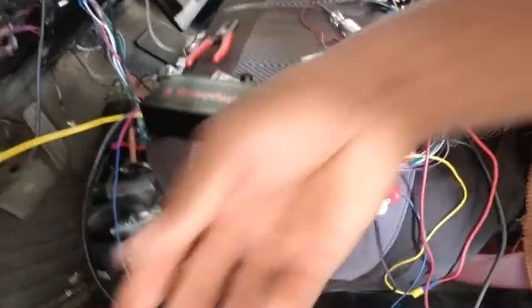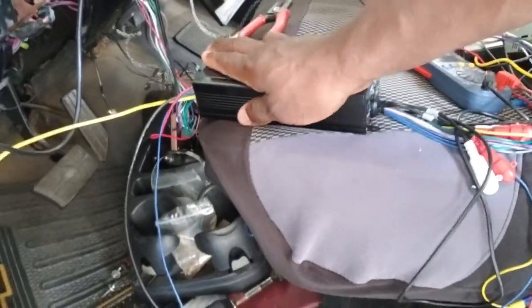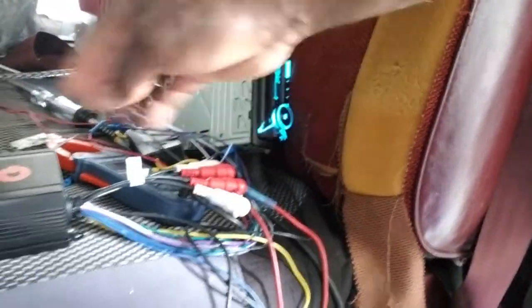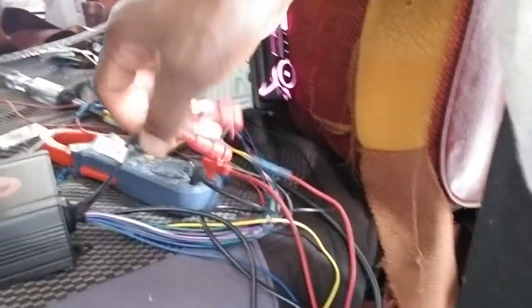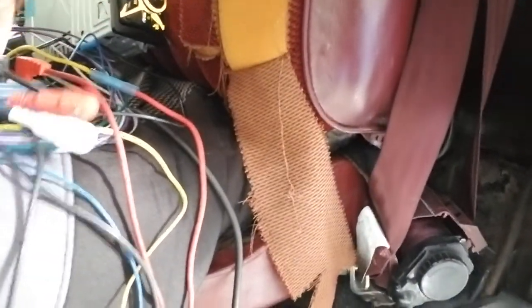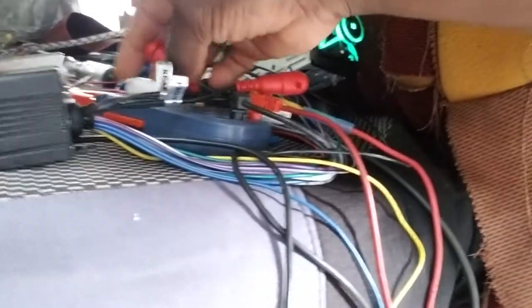I hope this helped. As you can see, I do have the little amplifier hooked up and it's really pushing these speakers real good — I'm pretty surprised. It gets a little warm, but it's doing awesome. I just got my stuff temporarily mounted just to test it out and everything, and it's going great. You don't need these outputs unless you want to run solely off of them, and that would mean no output power for an amplifier — they're your low-level inputs. I'm not using these. You'll hear noises if you're holding them with your hand, but as soon as you let them go the noise goes away. I recommend putting some tape around these things to shield them a little bit better — fold them back away from each other and tape them up to minimize any noise based on whatever it may be mounted around.